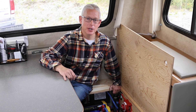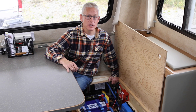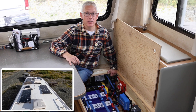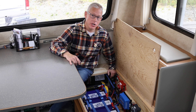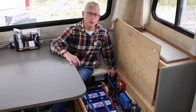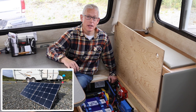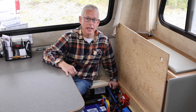So how do we keep the batteries charged? We have four different methods. Our primary method is solar. We have four 100-watt Renogy solar panels mounted on the roof of the trailer. They're all wired back to this device, the solar charge controller, which is used to regulate the voltage and charge current going to the batteries. We also have a 100-watt portable solar panel that we place on the ground and plug into the outside of the trailer just when we need it.